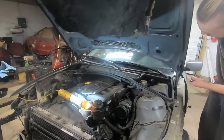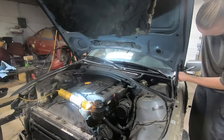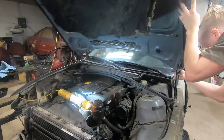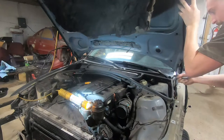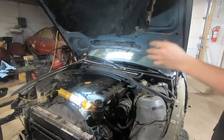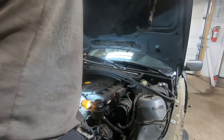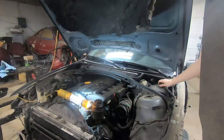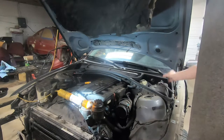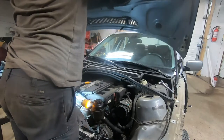With the back bolt on that side removed, I'm going to come over here and remove the back bolt on this side. The front two are still there but they are just on loose. Make sure you keep your hand holding the hood up here. I've gotten that bolt out now, so now it's resting on the top two which are somewhat loose. I'm going to try and slide it up — it may not work because I might not have them loose enough. Keep your hands up on the hood to keep it there; you don't want it to bend on you. There we go, it's loose now. I'm just going to come under here, lift up both sides, and you'll have the hood off.